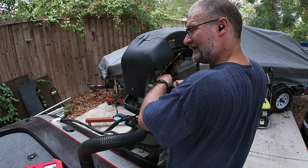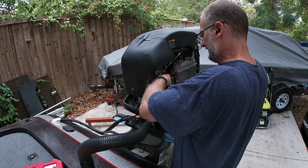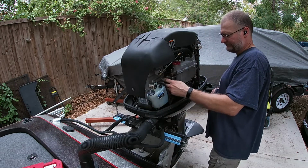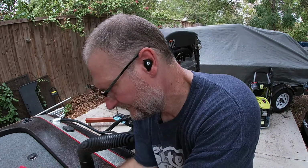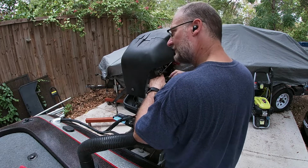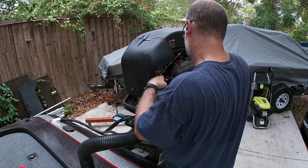Remove the two bolts that mount it to the vapor separation tank, or VST. Remember, everything comes apart. Pay attention. If you're not sure, use your phone. Everybody has one. Take a picture. Typically, that's what I do. Lay things out where I can find them and articulate where they came from. So that's the bottom bolt. That's the top bolt. Yeah, I said boat. Texas thing. We face it up the right way.